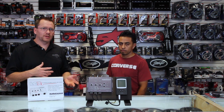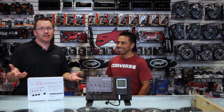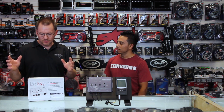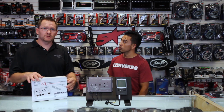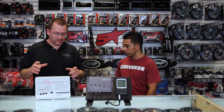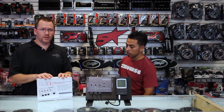So they have these radios in the dash and a lot of people just don't want to take them out, because what are we going to sell them? A radio that has exactly the same features but sounds better. With that, what do you do? Well, obviously you're going to need some form of a line output converter. Audio Control, in my mind, is one of the leaders in line output converters, and their products are the LCs. In this particular case, we have the LC7i.